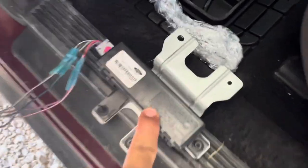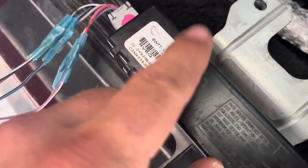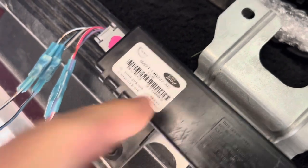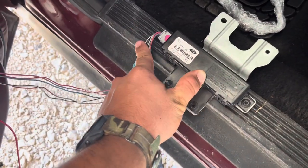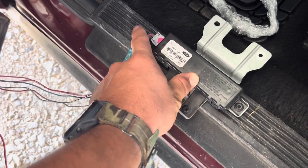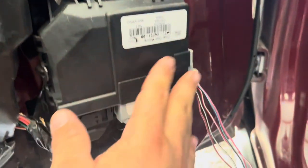So this is the antenna module I was telling you about. Like I said, it's normally located in that rear C-pillar right there on the passenger side. That part number is right here — it's 6W7T-14B207-AC. You do need that part; it's going to look just like this. You've got to make sure either you find a connector, whether you rob it off of a parts car somewhere, or if you get lucky like I did and you find this antenna with this gray plug. Because you will need this. On my car, this is the driver door module right here.